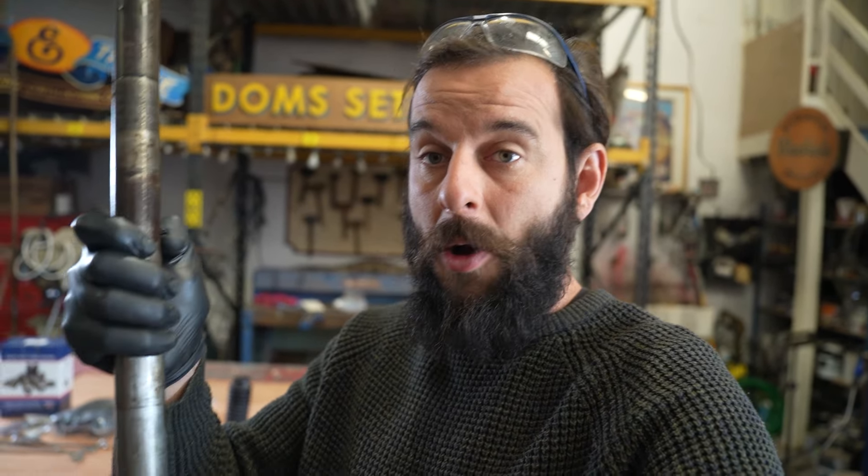The solution is new stanchions - look at them, beautiful. This old one is so badly pitted the bush won't even slide up and down it. Now we've got it completely apart, the process is: clean up the fork lowers, clean up the nuts and bolts. I've got new bolts, new seals, new stanchions, new rubber gaiters, new clips - all the new parts we need. I'm slightly nervous that bits could be wrong - the length of the stanchions, thread of the nuts, diameter of the gaiters. The only way to find out is to lay it all out and try to get it back together.